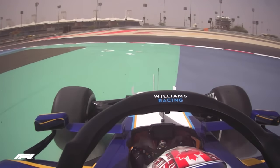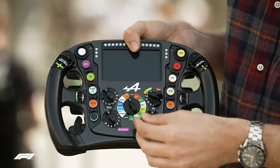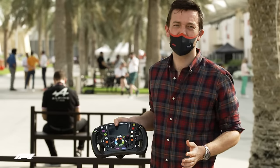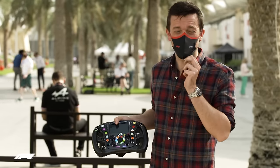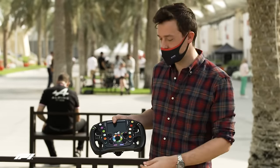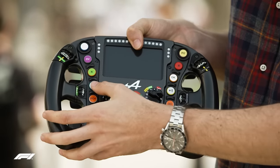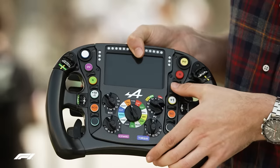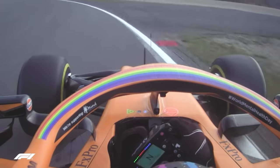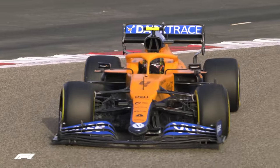There's so much more as well beyond just those performance aspects. You've got this big rotary, this multifunction switch, which is full of absolute detail. You've got fail A and fail B — these are things you hope you won't have to use in a whole season, but from time to time the engineers will pass on information during a race: 'You need to use fail A now.' So the drivers would have to flick through with the plus and minus to find the right one on the dash and press OK to confirm their fail A. They're basically control-alt-deleting their own problem from the car. It's quite clever, but it's hard work — a lot of switch changes while still driving flat out in the middle of race conditions.